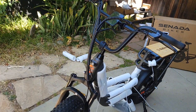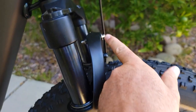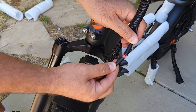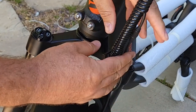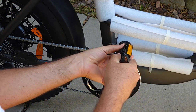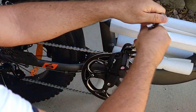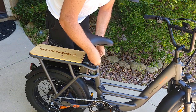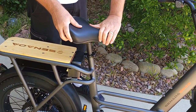The next step is attaching the fenders and the headlight. Remove the bolt from both sides. Once you attach the fenders and the light, re-plug the cable — you'll see two arrows, just align them and push from both sides. Next, attach the pedals — right to the right and left to the left — first by hand then tighten with the wrench. Then insert the seat post and adjust based on your height.